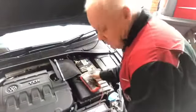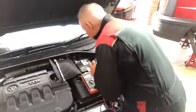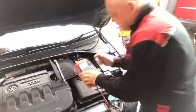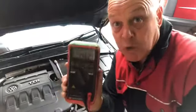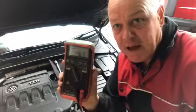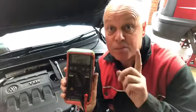I'm going to put the meter back on — this is for the engine running, and obviously it should be charging. We're getting 14.61 volts. That voltage is fine. That tells me the alternator is working because from cold we had 12.63 volts, and now with the engine running we've got a reading of 14.64 volts. A very quick simple test to show the alternator is charging this battery, so what we're taking out is being topped up.